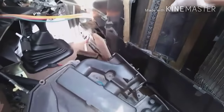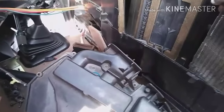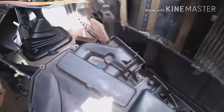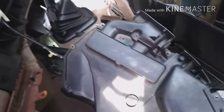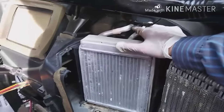To get to the heater core you just have to pull this piece off. This one comes off — just wiggle it and play with it and it comes up. Then for the heater core, you have to remove the hose that connects to the engine from outside.